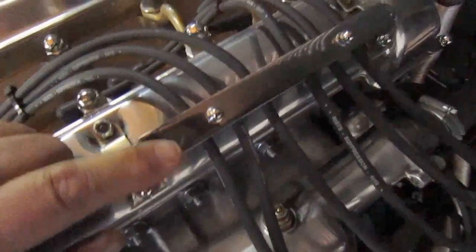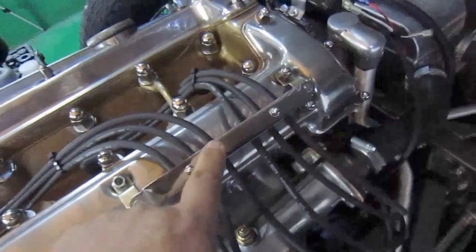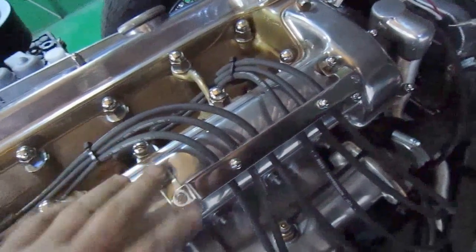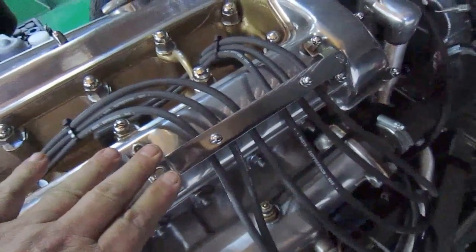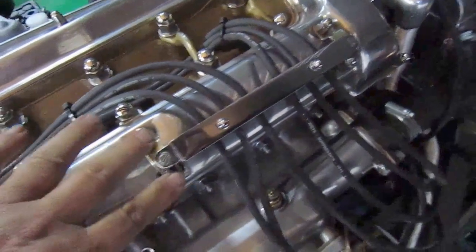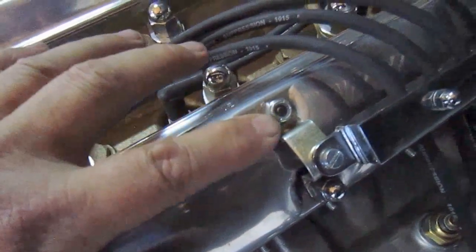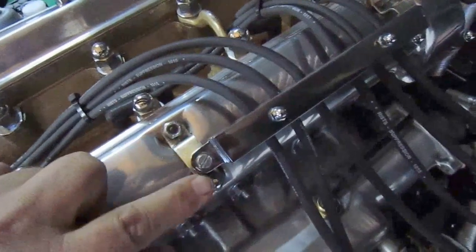The new ones are very, very good. But just a word of warning: when you buy them, they do look great inside. I bought this chrome cable harness to hold the cables in place, which does look neat. This is a new one from S&G Barrett. There's another style which has got Jaguar engraved in it, and they've got brown ones and all kinds. In fact, this is how they used to be on the C-Type. But what I didn't realize is — because this is new from S&G Barrett — you need the clamps to go across. I assumed this fitted directly onto the cam cover nuts, and it won't because of that recess there. So if you're going to buy this style, you must make sure you buy the clamp that goes with it.